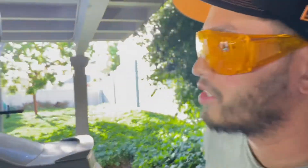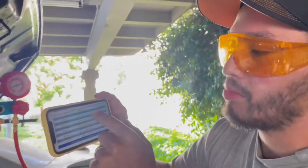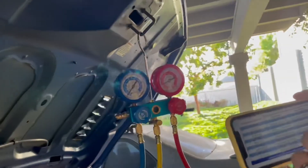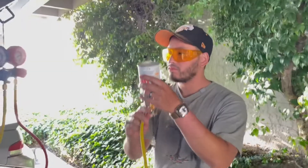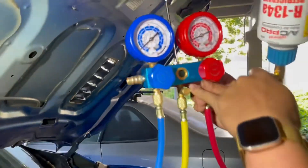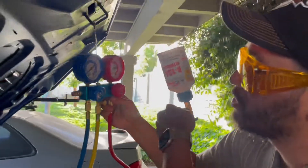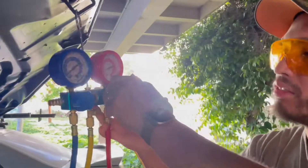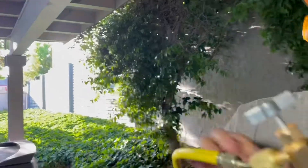There's still a little bit left in the can so I'm going to empty it out. Right now it's 65 degrees ambient temperature — at 65 degrees I'm aiming for 25 to 35 psi on the low side and 135 to 155 psi on the high side. The can is pretty much empty now — I don't see anything in the sight glass except air. We're going to close off the valve and close the low side. Low side is closed; high side has always been closed.